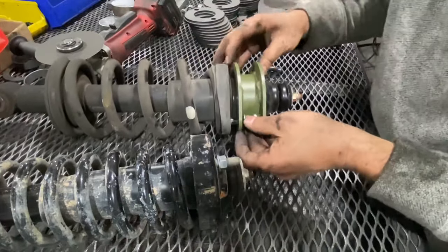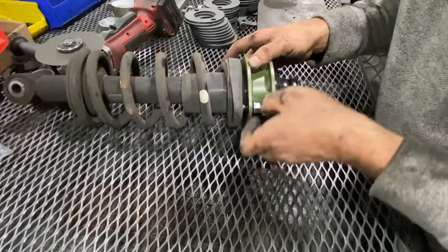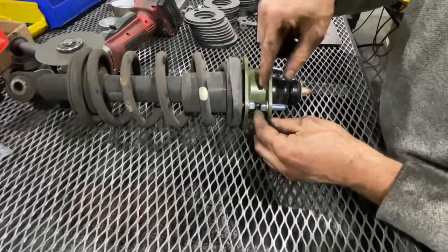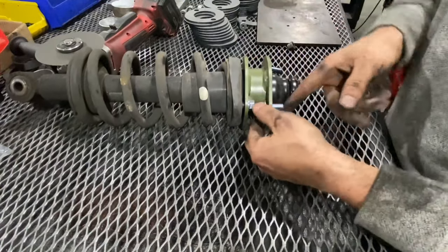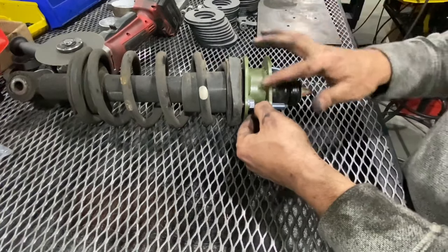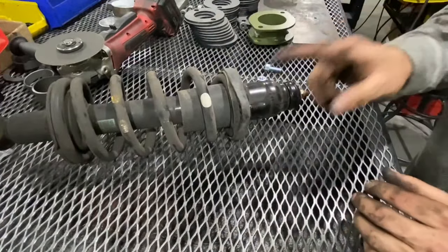Basically you can see where these go — the nut goes on like normal and then it sandwiches it in like this so that this fits flush, and then this bolt will just be captive right there. When you put this strut back in, this will help support the bolt so it acts just like another stud, and then you put a nut on from the top just like you would if you were installing the original strut. That's pretty much the gist of that — we're going to go ahead and put this in.